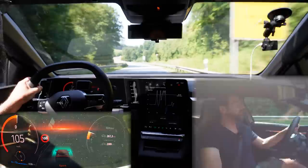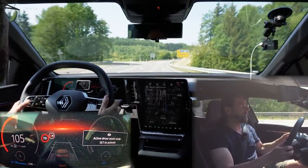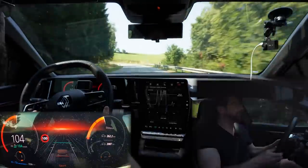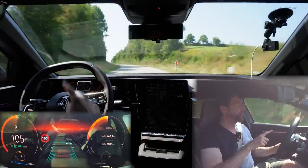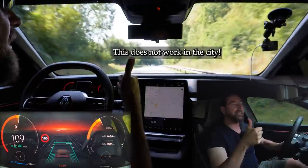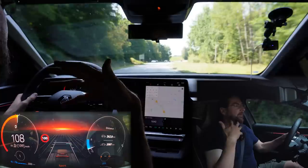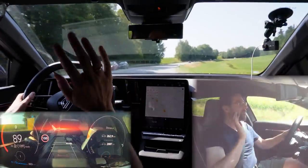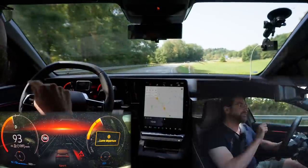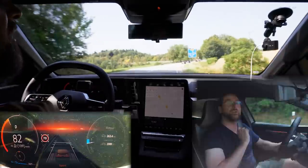Let's go on the highway and show you the assist systems, which are awesome. On the left you have your speed limiter and your adaptive cruise control with self-steering. You press that, set it, and now it's driving itself. When you press this button on the left, it adjusts the speed to the speed limit plus or minus a value you set in the car system — I set it to plus nine, and that's why it's now at 109 kilometers an hour. That is so awesome. Another amazing feature is when you turn off cruise control, it's not braking with full regen right away — it fades in gradually. In my ID.3, I have to press the accelerator pedal before I turn it off to avoid a jerky movement. This is awesome.